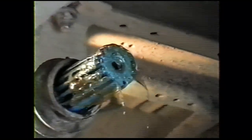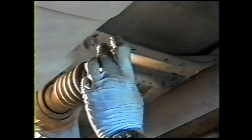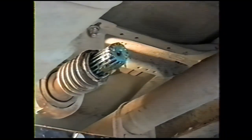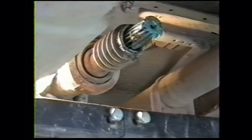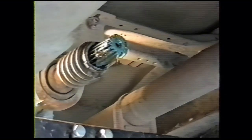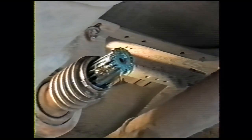You told us that you had a club cab when you placed your order for your kit. We supplied a new band for this boot. Slip that on like so. And we previously marked the drive shaft to keep it in phase. We've got yellow marks on this particular one. I have a yellow mark here. We just have to line those marks up.